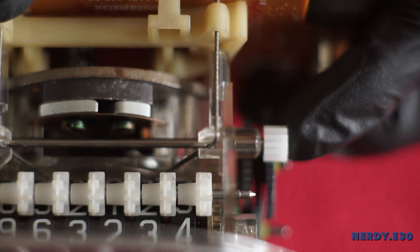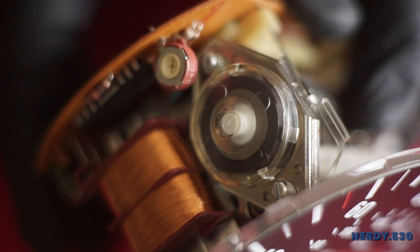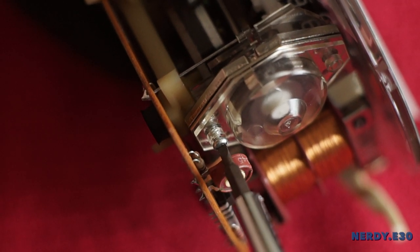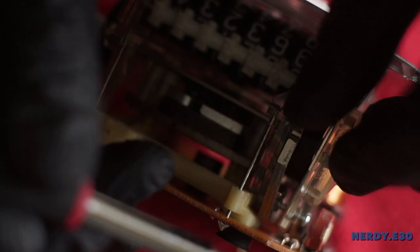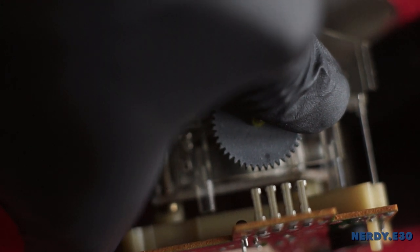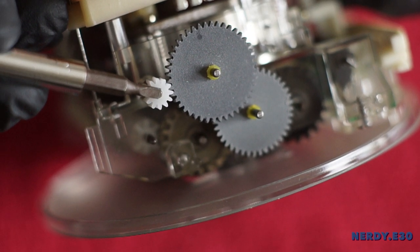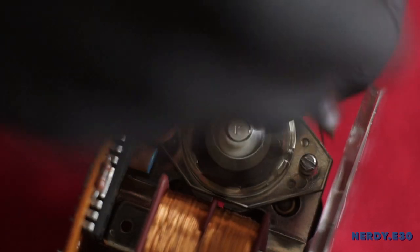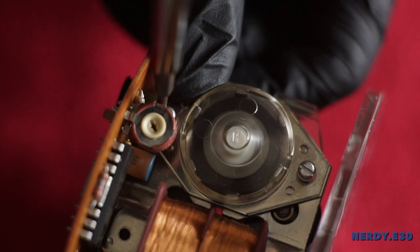As for the micro gear, it won't go all the way in due to the spring-loaded play, forcing us to remove its back plate to prevent the spring from deploying — allowing us to fully push the gear into place and eliminate the play. With the flathead micro screwdriver, loosen both screws. The bottom one will be tricky to get to due to the regulator on the board. Holding the shaft in place, press down on the tiny micro gear and set it in place, making sure it's flush. Since the gears are in place, fasten the back spindle cover and tighten the two flatheads. Use quarter turns to make sure you get it nice and tight.